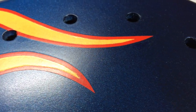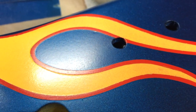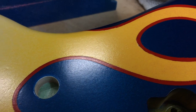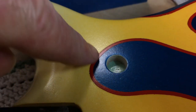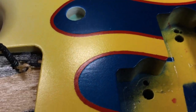This is coat number two and it's dry. I've had it dry now for a good week. It's still fighting time. The weather is still holding up, so that's good. Today is a good temperature to get outside and get the third coat on. But first I have to sand this — you can still see a little texture. There's still a lot more work after the clear coat with polishing and fine grit sandpaper.